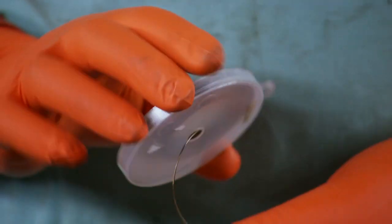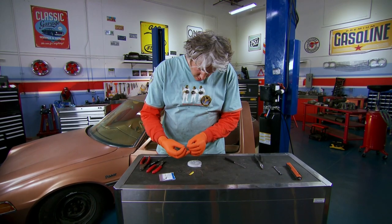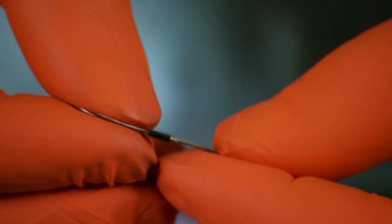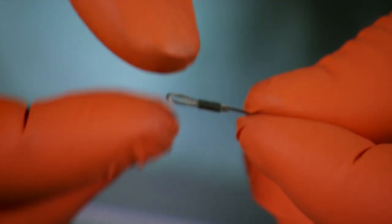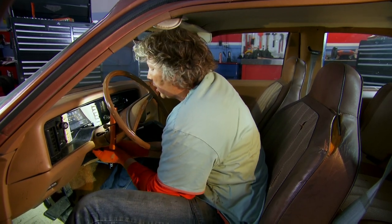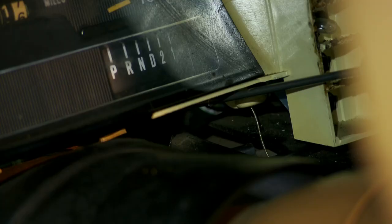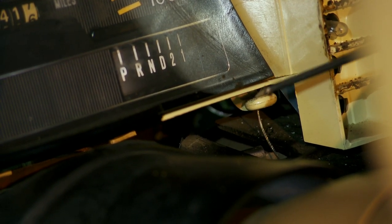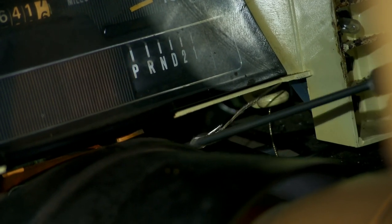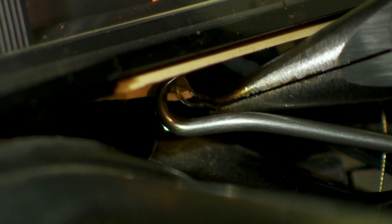Just to play it safe I'm going to replace it with one made from brand new materials. I've got some fishing line here — it's quite tough, about 60 pounds breaking strain or 27 kilograms. I'm going to make it up using these little crimp sleeves on either end. The finished product will be very strong and should outlive, hopefully, the life of the car. I've used the old one as a template to get exactly the right length. If it works, the total part spend will be just ten dollars — six quid. Mike will be very chuffed. I've hooked a big saving for the budget.